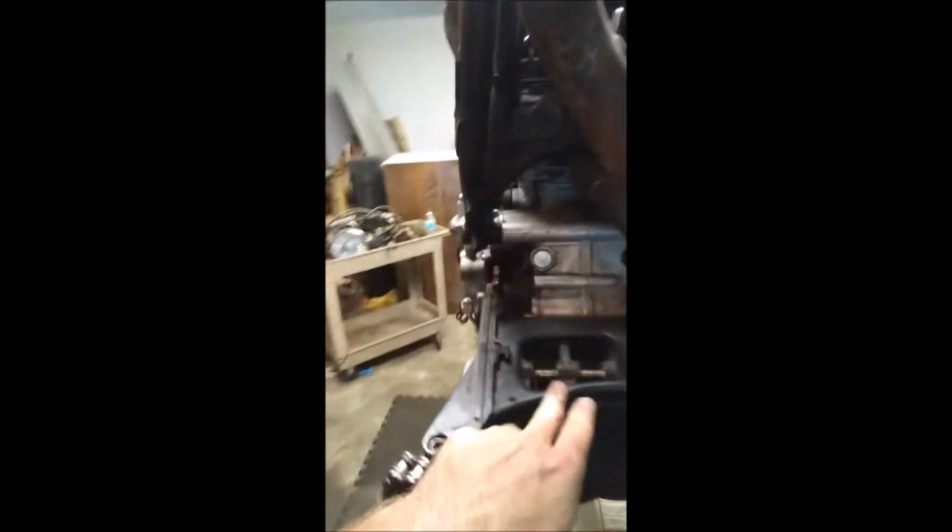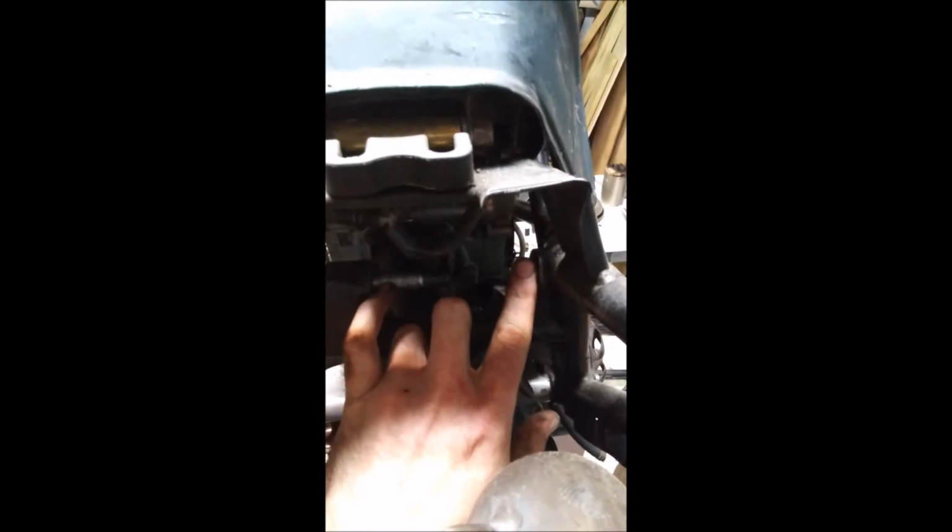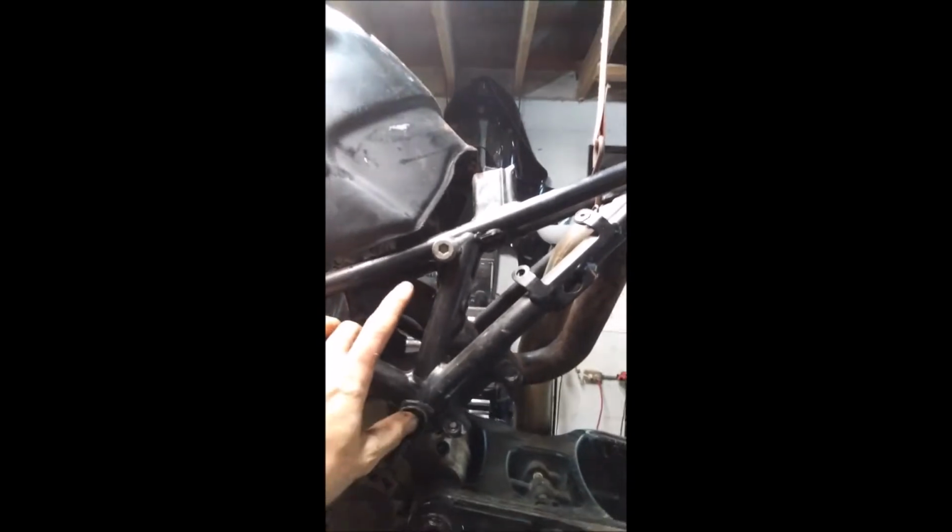This swing arm, you can see the shock mount is on the left-hand side of the bike. And you can see here, I don't know if you can see that, this is where the factory Monster 620 shock mounted. So what we have to do here is we'll take some very precise measurements, find out exactly where this is in relation to the motorcycle, where we want it to line up, and we are going to chop off this entire piece from here back, and we will build our own subframe that has the shock mount on the correct left side of the bike.